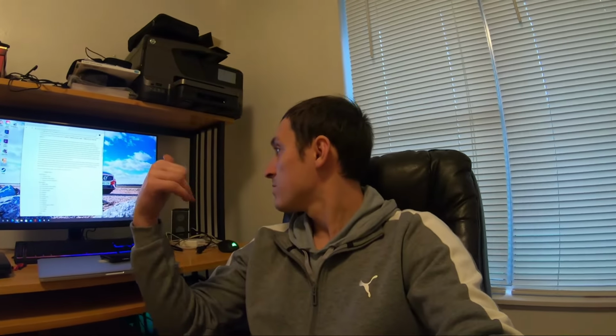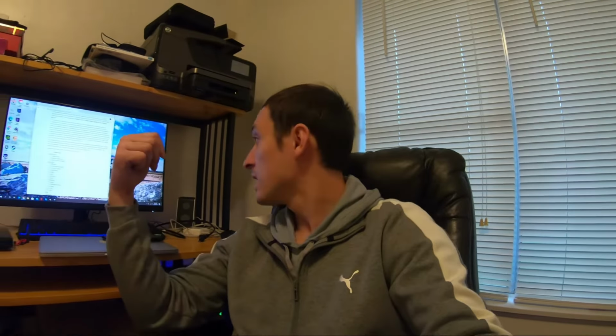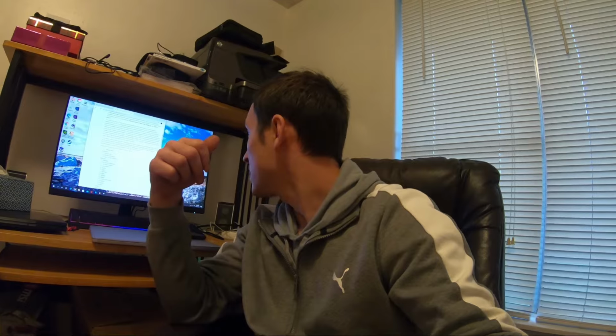Doing my research, the TF-80 from 2010 and older uses JWS 3309 fluid, and the 2011 and newer generation 2 transmission uses JWS 3324 oil. So the ratings are different. It's a different type of fluid, so make sure you don't mix these two up. It's from 2011 and newer. It's pretty much a TF-81. So from 2011 and newer, it's a TF-81 transmission.